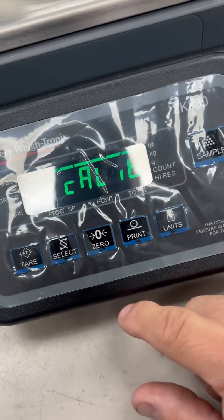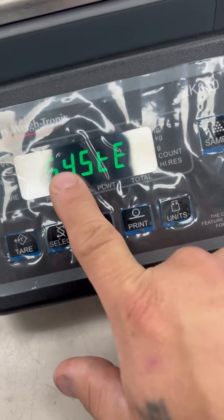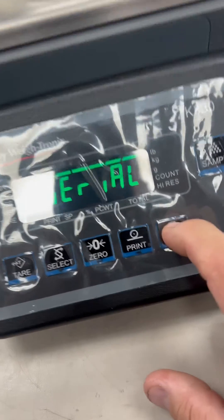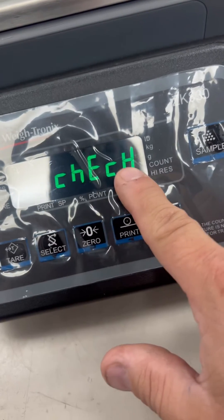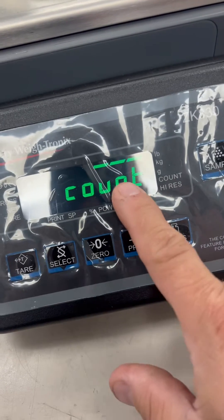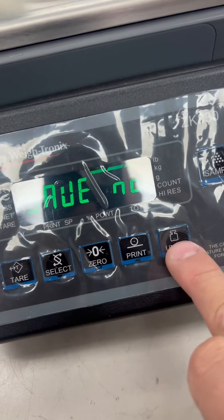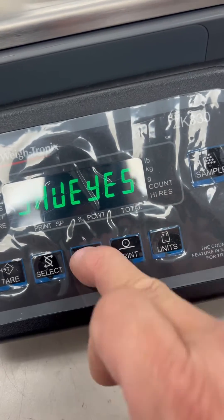You're going to go down over to System, then scroll over to App. Right now it's in check mode — you want it in counting mode. So go to General, pick Count, press Enter, then use the right key to go up and change that No into a Yes, and hit Enter.